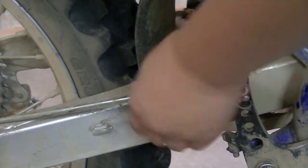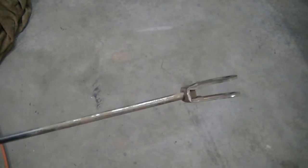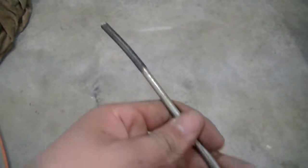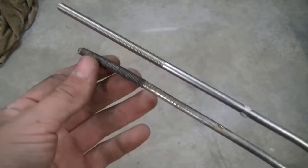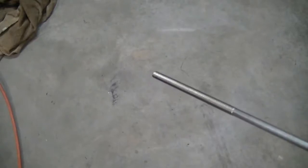Now what you've got to do is take the front of the rod off. There's a little pivot point right here — all you do is just pull that out and set that aside for later. There should also be a little tiny washer that comes with it too — set this aside because you will need it. Now you can just take your rod all the way off. So now I'm going to show you the difference between an old brake rod and a new one. As you can see with this old one, the front of the brake rod is actually very bent, and also the back of it is very bent and also cut off. The threads are really black and dull and screwed up, and this new one is perfectly fine.